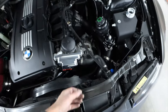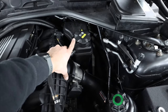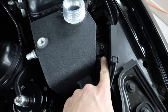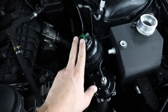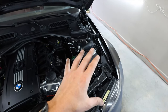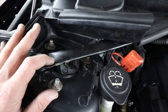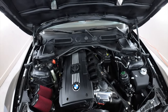When we originally put this engine in, we sort of just plumbed things however best we could and made them work. This location is trash back here for the coolant reservoir. I'm really hoping that I can keep this reservoir - the new one that I got is from Turner Motorsports, made for a 335, but it bolts right up to the factory locations. Looks really good. It also has a bracket for the power steering reservoir, which is nice, so that just makes everything fit so much better. Really hoping that I can retain that with my new intake manifold, but I might have to adjust some things or make some custom brackets. My strut braces are just destroyed and look horrible, but I got something coming for those as well - I'm going to be doing a pretty cool little DIY retrofit.